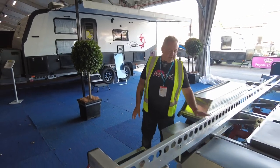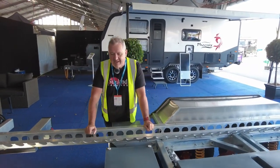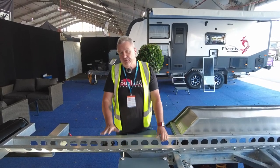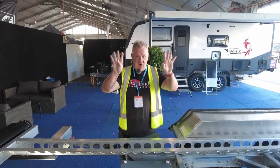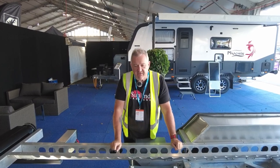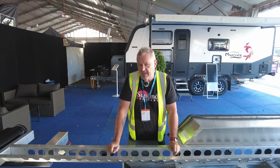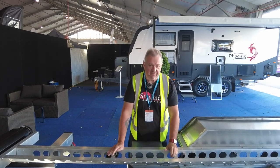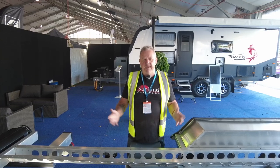All up, this chassis is designed to be as light as possible and as strong as possible. We use basically the same chassis whether it's a two-ton or a three-and-a-half to four-ton application, with exactly the same materials. We set our safety factors based on three-and-a-half tons, and at that rating this chassis has a safety factor of nine. The government's VSB1 recommends a safety factor of three for a road caravan and five for an off-road caravan — this chassis has a safety factor of nine, way stronger than even the government-recommended level.